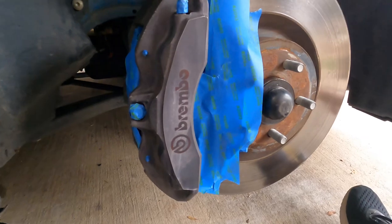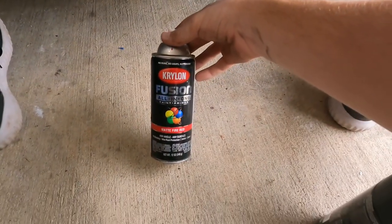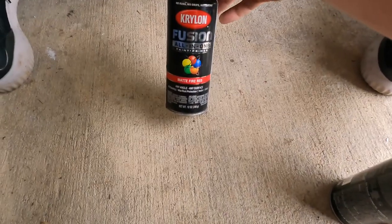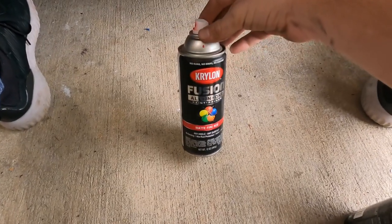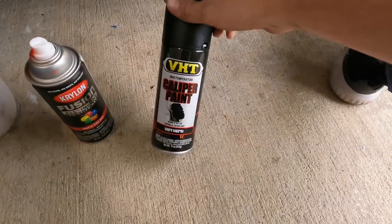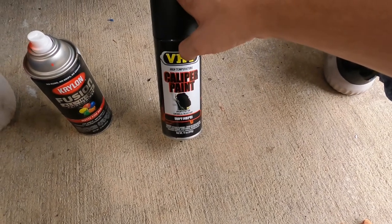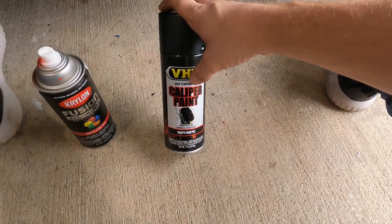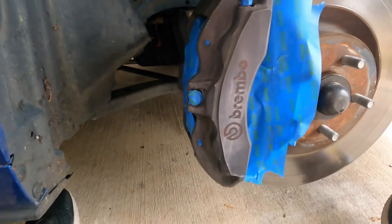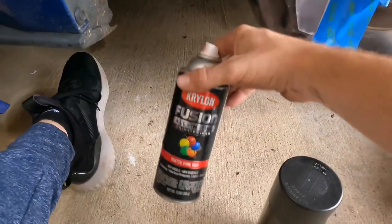So let's look at this — this is the paint I'm going to use. It's just a regular Krylon, matte fire red, a bright red paint. Obviously it's not a high heat paint. So what you want to do is get something that is. This caliper paint works — it's high temperature obviously. Or I've had really good luck with engine primer or high heat primer. Basically what you want to do is put a couple of coats of this over the brake first, just to help hold some of that heat in and keep it off your regular paint.